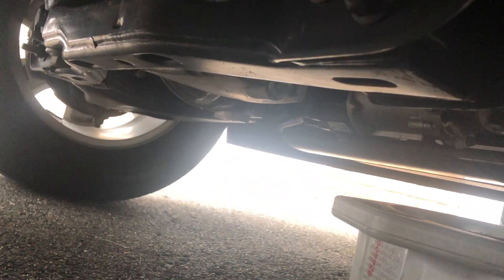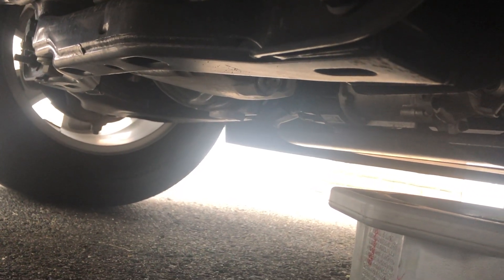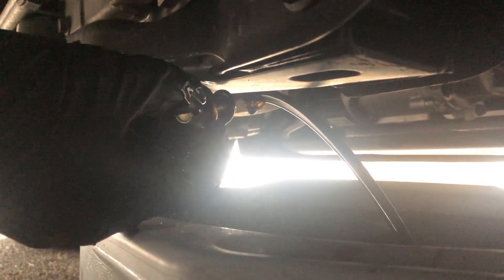While that's draining, we'll go back up top to multi-task. We'll break the oil filter loose and get that cartridge out, then put the new one in once it's all empty. All right, broke it loose — just gonna spin it off by hand. Make sure you got the washer with it.